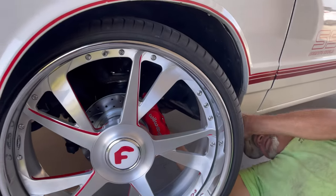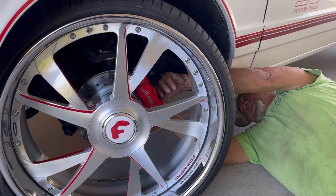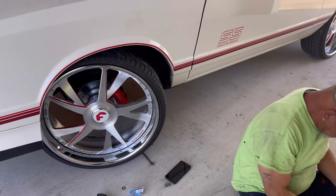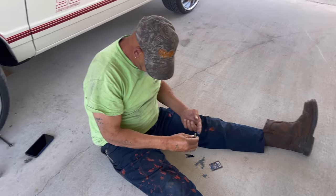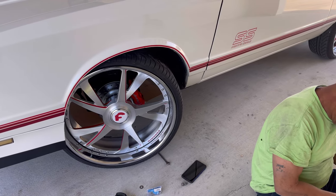That's gonna be good. That's gonna tighten up. You got me right, huh? Again, Old Red came to the rescue, man. The bolts were too long. They had three or four washers on each bolt. They ended up backing out. Well, one ended up backing out all the way and one was hanging on. He said that one was loose. So we went and got some shorter bolts.